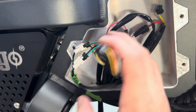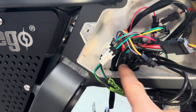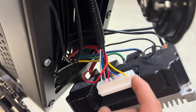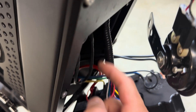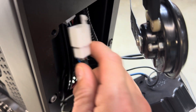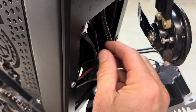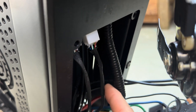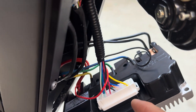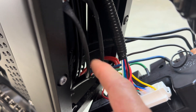First thing is the wiring in here. As you can see, there's no place for a 4-pin to plug in. The wiring harness goes down into the controller, and there's one that goes into the horn. There's nowhere that has a plug — it's supposed to be a 4-prong coming off of this to be able to plug it in. The only other empty plug is coming off the motor, and I'm not plugging it in there because I'm not about to fry my motor sending the wrong signal. This one goes from the motor up into the controller, and that's how the wiring works. There's no other plug.